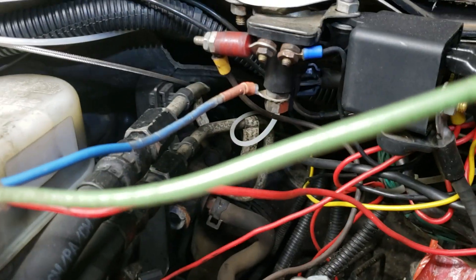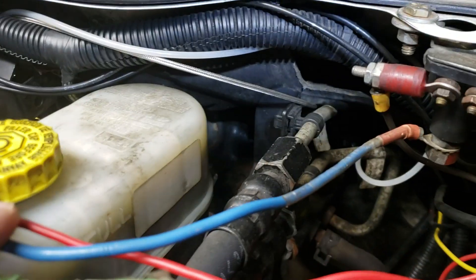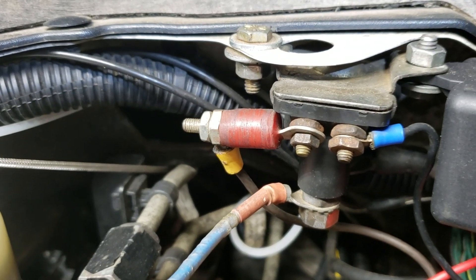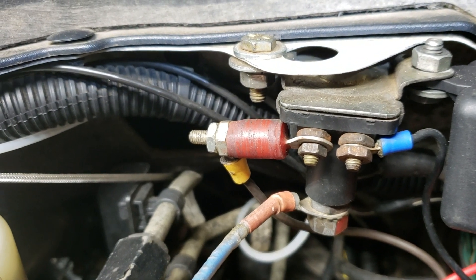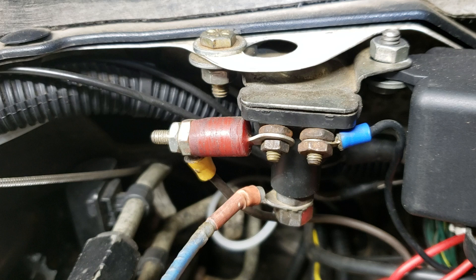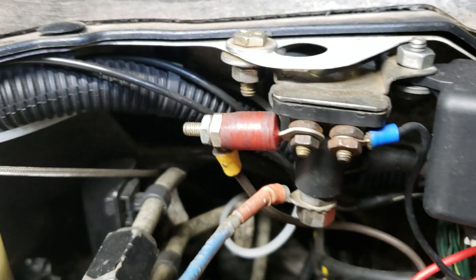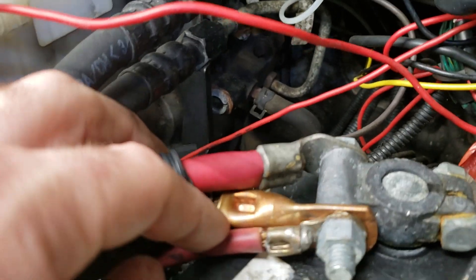The pull wire is only on for a little bit, and that's precisely because it's using a ton of juice. This is a grid heater relay. Grid heater relays are not continuous duty — we've gone through three or four of them trying to find relays that would work. I'll put some examples online; you can also get them at Lowe's if you need new ones.